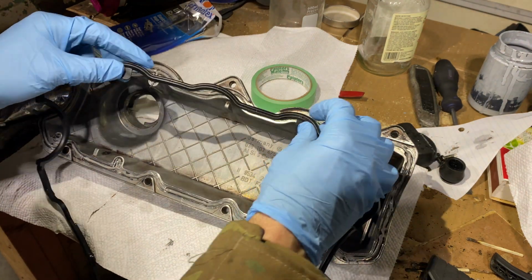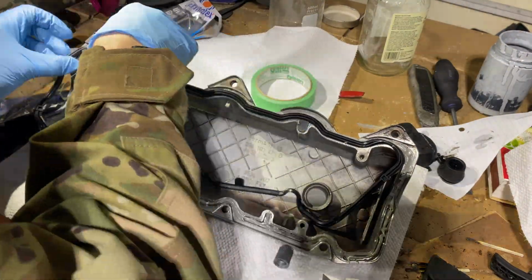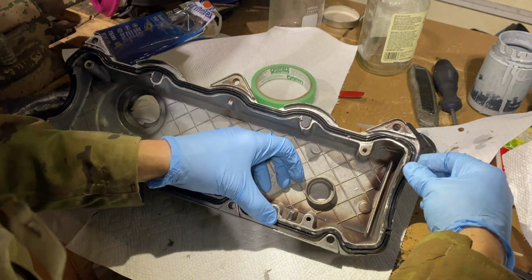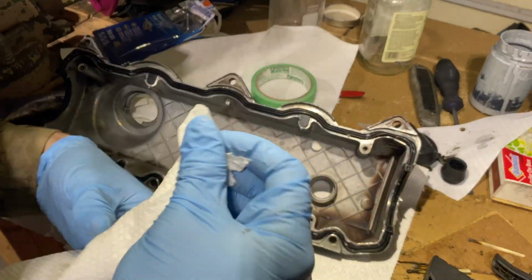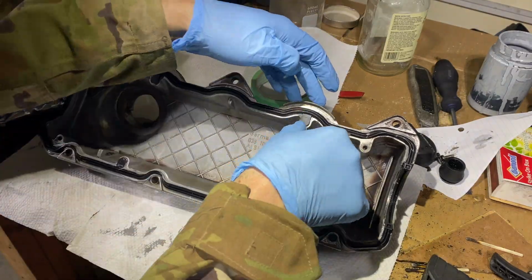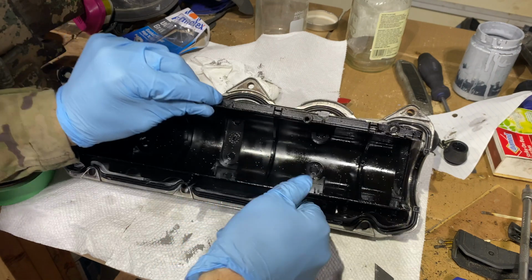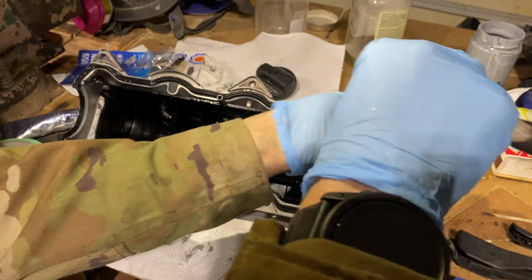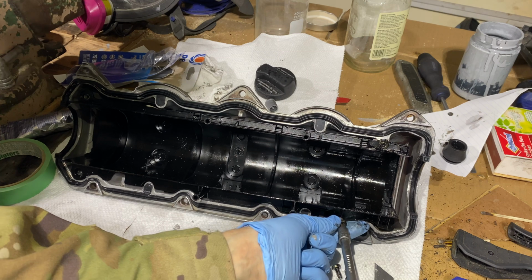With that complete, my hand is almost cramping, so that's a perfect time to put this gasket on. I'm not worried if there's some getting squeezed out to the outside, but if there's stuff on the inside, I'm going to wipe that away a little bit. I'm going to put this tray back into here. And as you can see, these bolts are diagonal, so there's only one way you can put it in. They make it easy for us. Snug, you're just holding in a plastic piece into some aluminum. Don't make it too over tight.